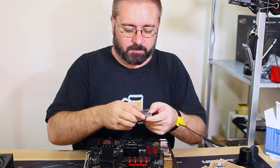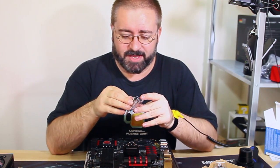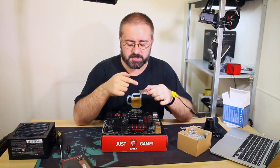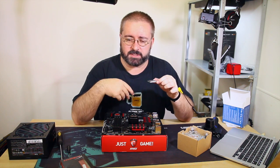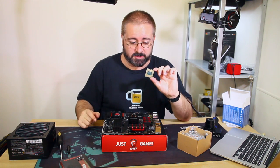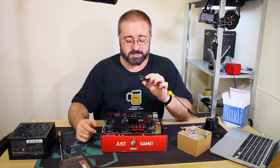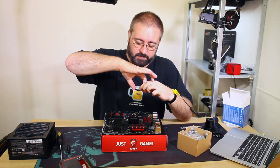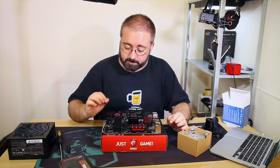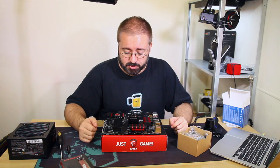Carefully open the little plastic package making sure the CPU doesn't fly across the room. We won't touch the top of the CPU - it's tempting because it's shiny, but finger grease creates air gaps and interferes with the cooling and thermal compound. Never touch the top, and certainly don't touch the pads underneath because even low-level static could cause severe damage. Hold it by the edges. You can just drop it into place - no force required. It will only fit in one way because of the notches on the side. Don't force anything. If it's not sitting flush, you're not doing it right.